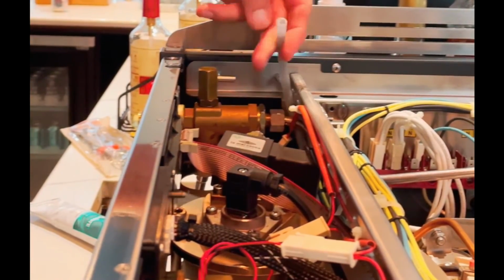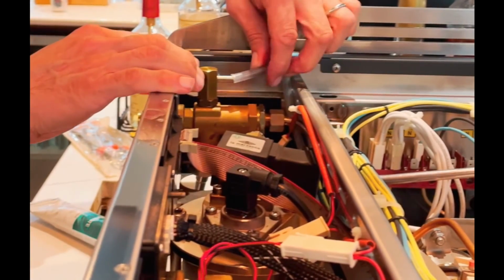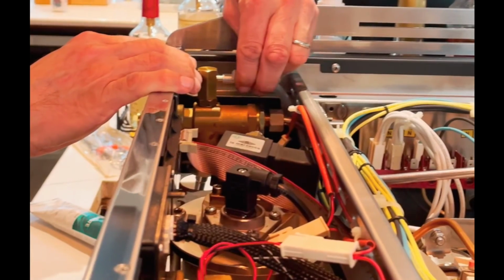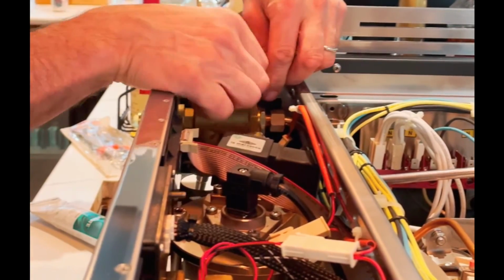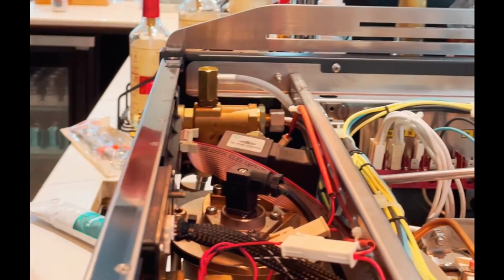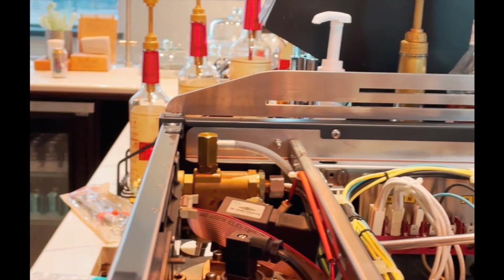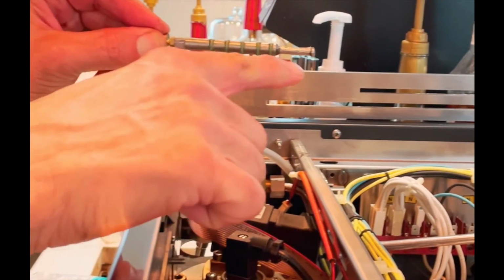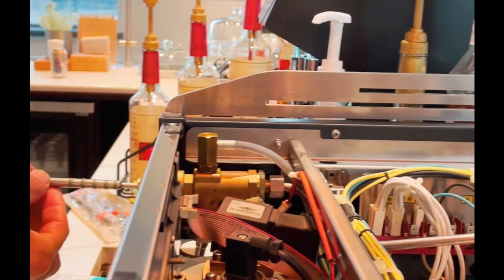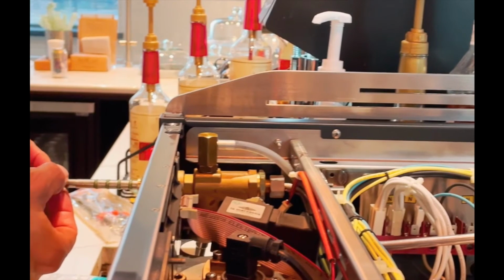We do have our relief valve tubing. We're going to slide back in while we're here. Remember, we're going to have to put zip ties on these because we cut off the original ones. So we're going to have to re-zip tie this on both sides. And then that brings us to our valve stem, which, remember, I put quite a bit of lubricant on the end of this thing. So we are now able to slide this back in.